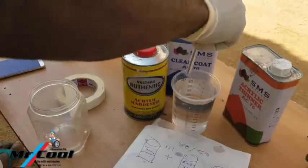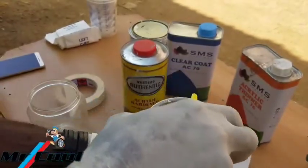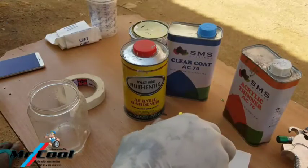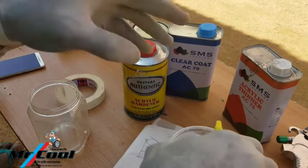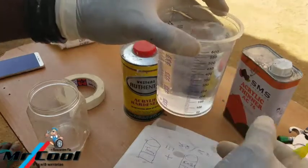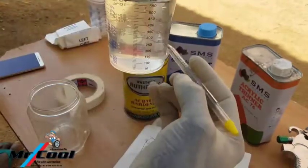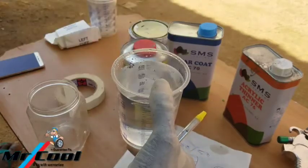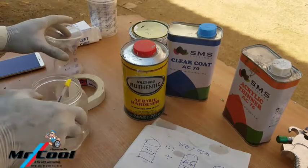At this level right now, you can't take something and stir it very well inside here. The big question is: when you pour it into the paint gun cup, there's going to be leftover. What are you going to do to protect it while you're busy painting, without distracting yourself? That's why this disposable cup is not always ideal. This scale is the only correct measurement tool for clear coat, thinner, and hardener combined.